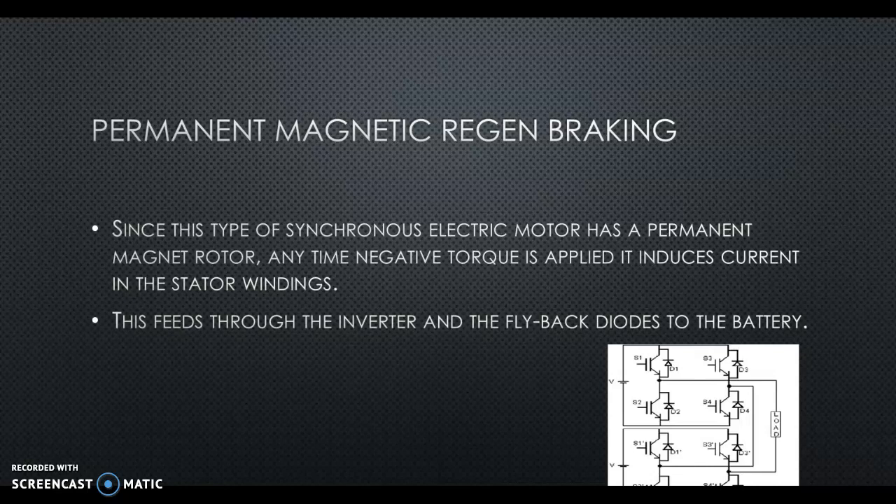As you create this negative torque, you're turning the motor into a generator. The power generated in the stator winding is going to go through flyback diodes to the battery, much like the diode rectifier bridge on an alternator — it's going to send that three-phase current back. In the hybrid system, the same thing happens in the inverter. As we generate that three-phase AC in the stator — MG1, MG2, or traction generator motor depending on the vehicle — that electricity is going to come back through these diodes and go back to the high voltage battery.